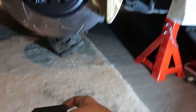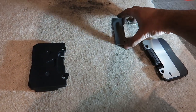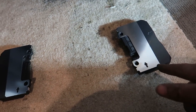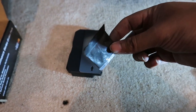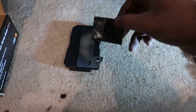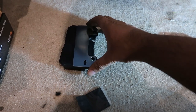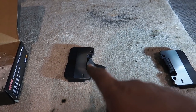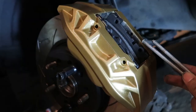With the pads, this one slides in on the front side - you have two shim pieces: one goes on there and this one goes on top. The arrow always points up. The back side is prepared the same way - arrow points up. It also comes with some grease; there are warnings about it being toxic so make sure you're wearing gloves. You spread it on between the two plates as well as the pad itself - it's meant to stop any noise over time. There are also two pins that everything slides through.